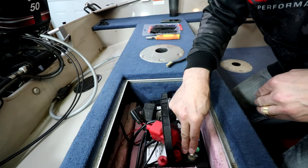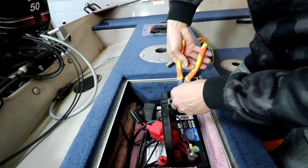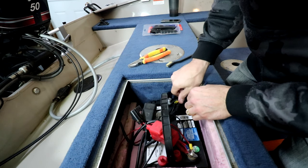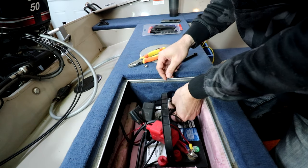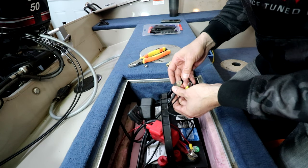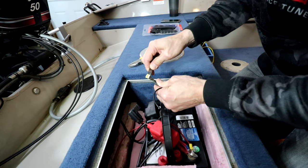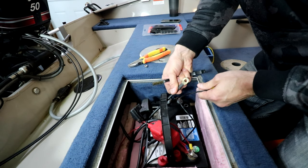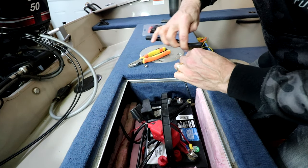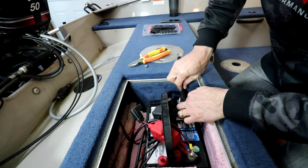The first thing you're gonna need is some pliers — just take off the bolt. Alright, now you've got all your wires off. You can see I've got a ton of connectors on here, and you're gonna want to make sure all of these are clean. Take your wire bristle brush and just clean everything off like this — do both sides and get everything nice and shiny. You can see this is shining nice and bright, all the corrosion is off. Do this for every single one, make sure there's nothing on there. Then go ahead and do the terminal post — go all around it and get it all cleaned up.